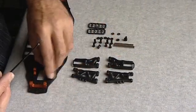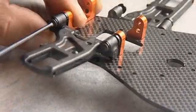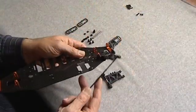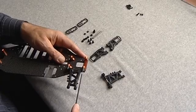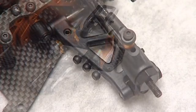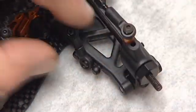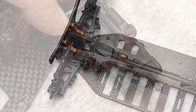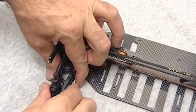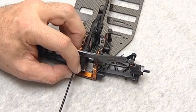We made new bulkheads, completely redesigned. The arms are now independently mounted from the bulkheads directly to the chassis, which provides more traction and more steering. We also redesigned the rear arms because the car was sometimes rolling too much on high-traction tracks. So we added one extra optional position for the roll center more outward, meaning on high-traction surfaces the car rolls less and is easier to drive.